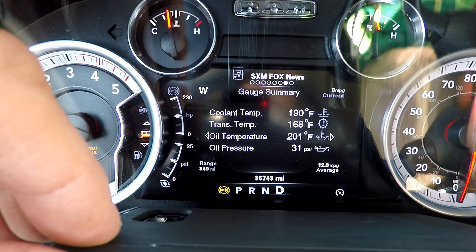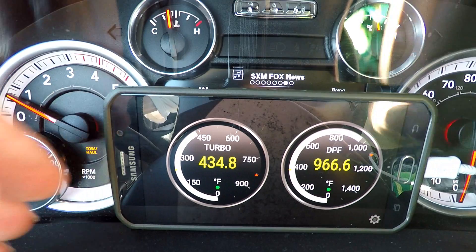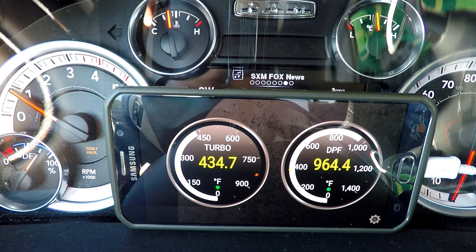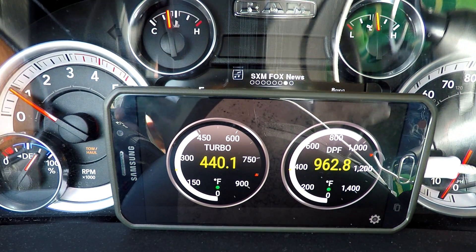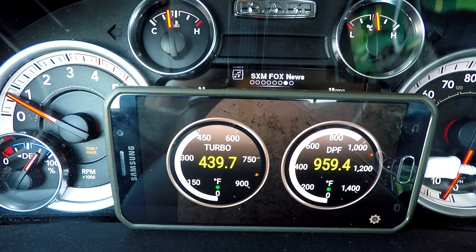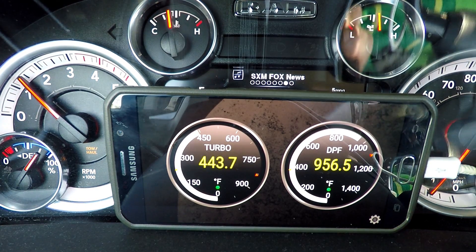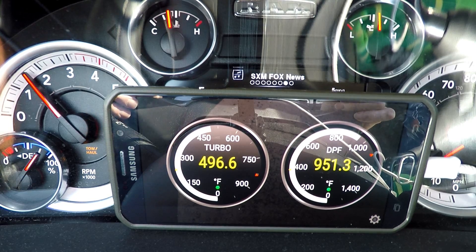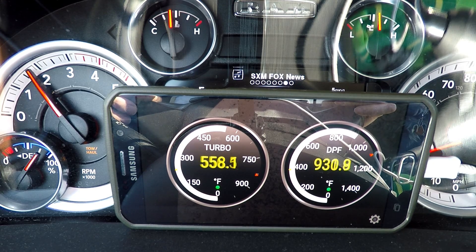That's a good thing because you want it to cool down fast even when you're in a regen. You wouldn't want your temperatures to stay very high while in a regen, at least on the turbo side. The turbo temperature goes up slightly when the truck goes into a regen, but from watching my CTS monitor it only goes up about 100 degrees or so. This looks like it's more sensitive and it's showing changes in temperatures either more accurately or quicker. This will do just what you want as far as watching the cooldown temperature on the turbo to see how long it takes.